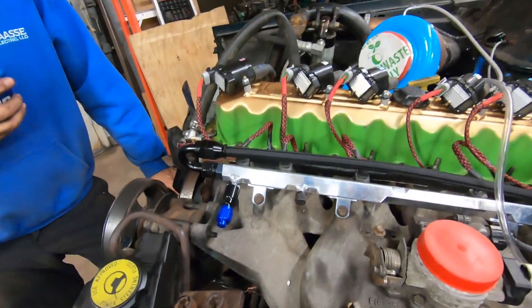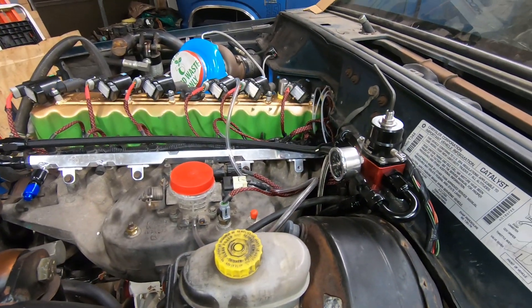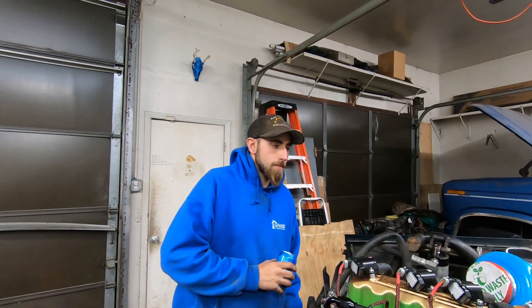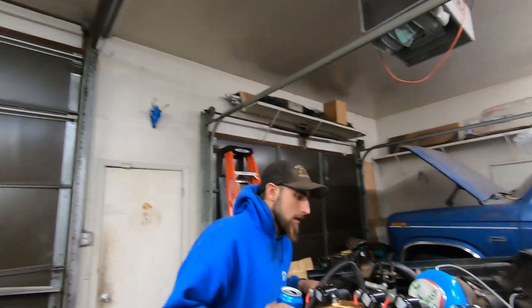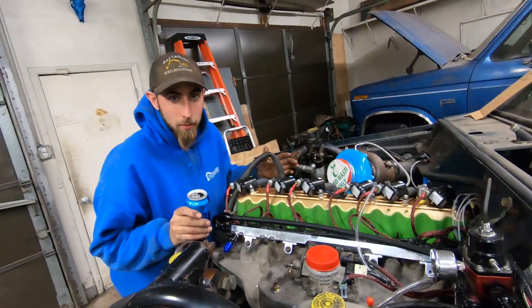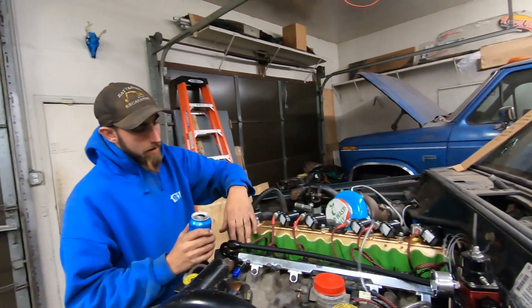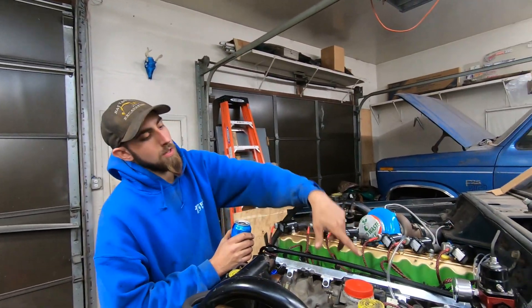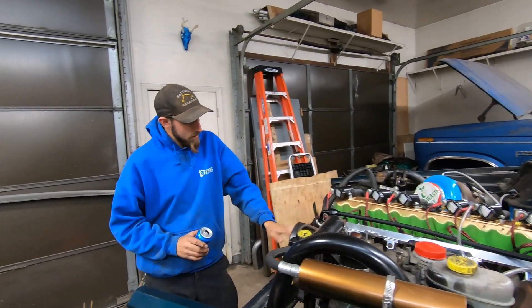One of the few silver linings is we're taking this intake manifold off and one of the bolts snapped for the fuel rail, so we'll get to figure that out and fix it. We were gonna try to do it inside here but no way. Once we pop that out, really simple. We can unplug all these sensors and literally pull this whole cable straight back. We'll take the fuel line off here and take this whole thing off with the fuel rail.